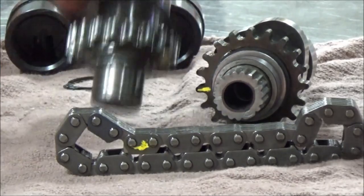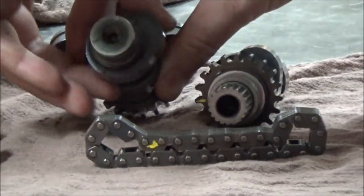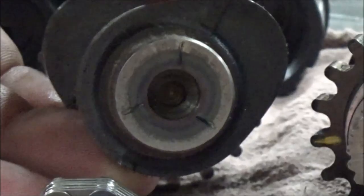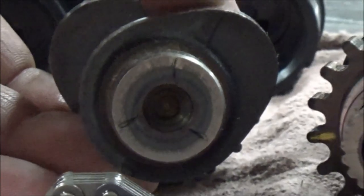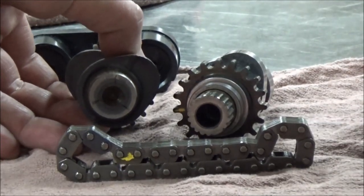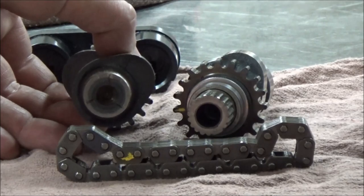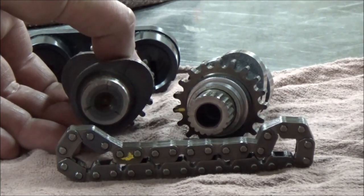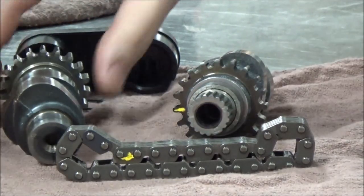I'm going to show you what unpainted ones look like so you can see — it's a little more difficult. Do you see those dashes there? Throwing a paint mark across there speeds it up. You're going to see Harley's done something pretty cool so that we can make it easier. Once we press these into the cam support plate, we're actually able to view it on the other side and verify that we haven't jumped time because we don't have a tensioner on there at this point.